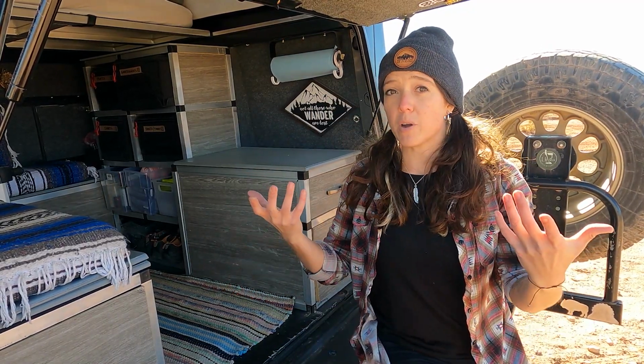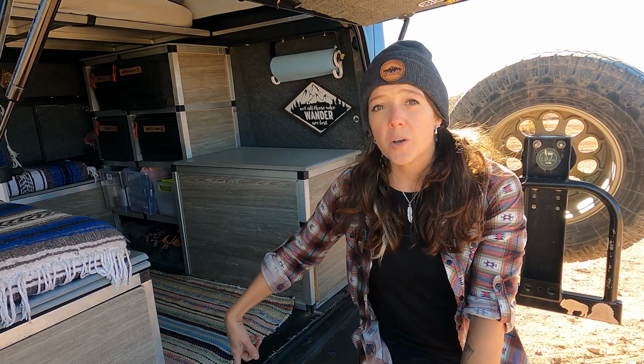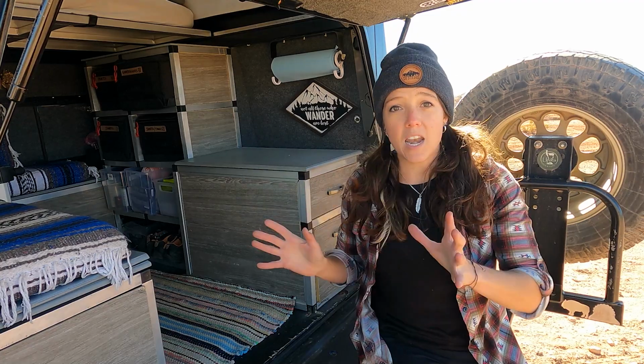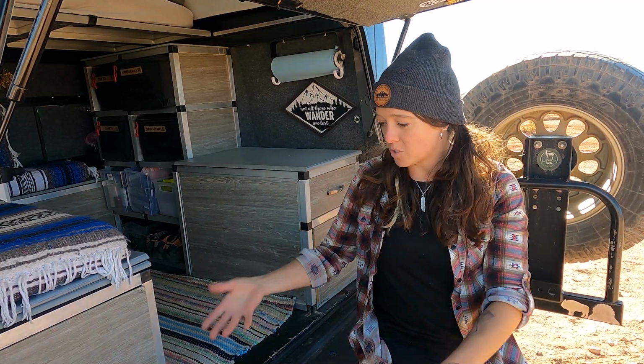Come in, let's go. One question that might come up, which I should answer super fast, is how in the heck these cabinets are mounted to the truck bed. Great question. This is a 1/2-inch birch plywood 5x5 sheet that I found and was able to cut to fit the truck bed. Tacoma World Forum was a big help for this. There's a full Drifter camper forum. So anyway, T-nuts were drilled through the bottom of that birch plywood. The cabinets were attached by those T-nut bolts, and then everything was bolted down to the truck bed with the truck bed bolts. Hopefully that makes sense. It hasn't moved since, so it's clearly worked, which is great.